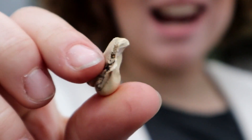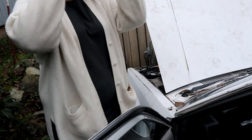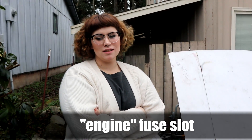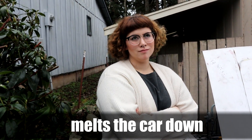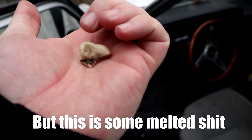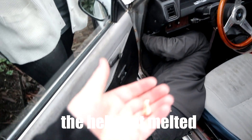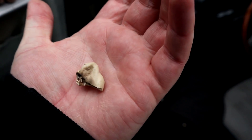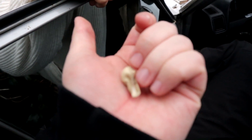Wow, that thing's rotten. So we got the car charging again. Maurice put a fuse in that engine fuse slot that we were saying was bad — the one that melted. The car charges again, which makes me feel silly. But this is some melted stuff on the back of the fuse box. Maurice is pulling the fuse box out to figure out why it melted. Looks like a cap or cover on something. I smelled it — it smells exactly like the smoke the car smells.